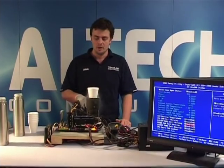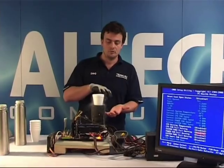What we also use to protect the motherboards further is Vaseline or plastic spray, or even nail polish around all the metal bits around the CPU, where all the little spots are, the ICs. You basically have to protect everything so that condensation doesn't short something or part of the components on the motherboard. That's crucial. Otherwise, depending on how humid it is, you'll probably end up having a lot of temperature problems, humidity related problems and instability problems fairly quickly, unless you do something like that. We've already prepared the board earlier using these techniques, and we've coated the entire area around the CPU socket, and also the area around the MCH, or the north bridge itself on the motherboard.